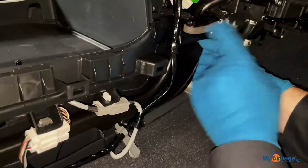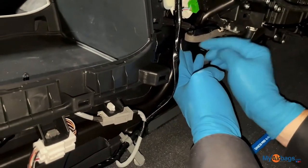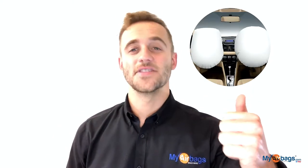It's actually connected on the driver's side, so we're going to go over there and do the same thing for that vent. Here's what you need to know: when the car gets into an accident, there are three main things that could be causing the SRS light to be on — the airbags, the airbag computer module, and the seat belts.